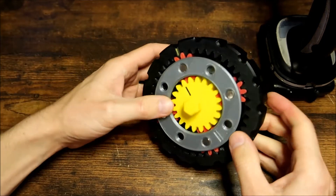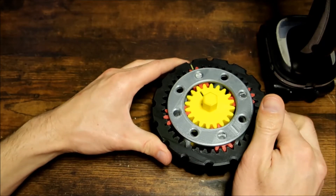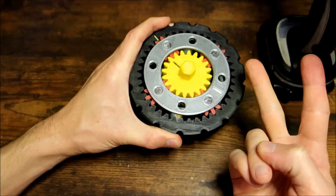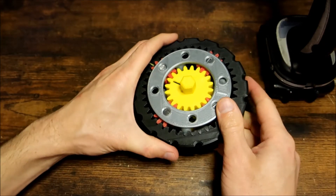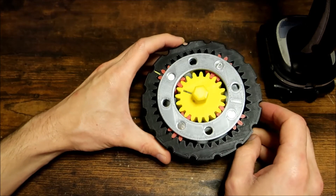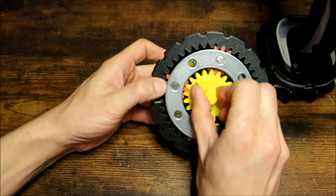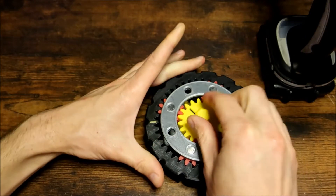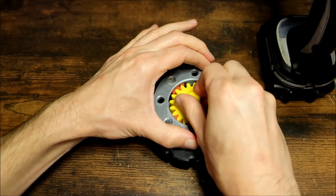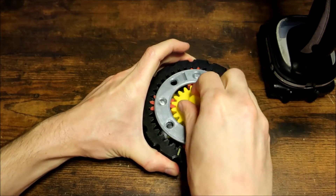So another example: what if we want something like a direct drive? We're taking off from a stop — let's say this represents a simple two-speed transmission. So realistically two gear ratios plus a reverse. We already saw a low gear or under-drive gear ratio like three to one, and then we just saw a reverse gear. But what happens if we want a one to one gear ratio? How is that achieved? To recap: if you want reverse, we drive the sun gear and hold the carrier. If you want a low gear, we drive the sun gear and hold the ring gear — something like first gear at a three to one ratio.